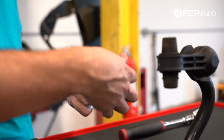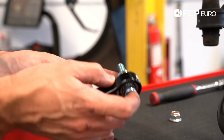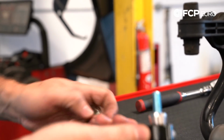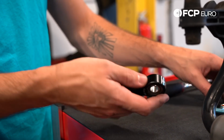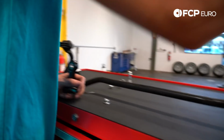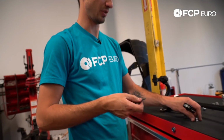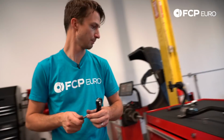You can see, basically we're going to have a bolt straight through and a nut on it, and that's going to pinch the bar. And that's going to allow the bottom to move. So to get started on that, let's get the bottom in place first. The bottom, we're going to be reusing the long sway bar bolts that go through the bottom of the trailing arms. But 034 has gifted us new nuts to go along with them.